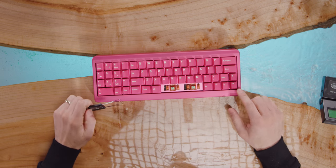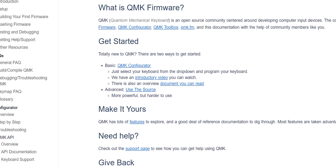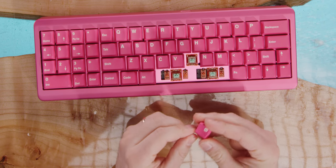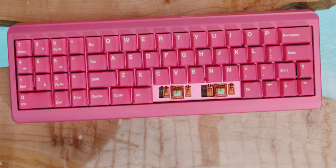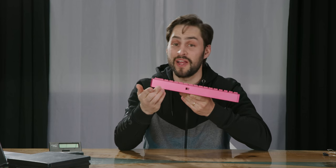After you're done assembling it, you're not quite done, because you actually need to program the layout you've chosen. On this one the arrow keys are all broken up and weird, but it doesn't have to be like that — you can put the key caps wherever you want. Then you program the QMK firmware and flash it on the board to do whatever you want it to do. It might sound a little daunting, but it's not that hard — there are lots of tutorials and tools online. These keycaps are dye sublimated, so they won't fade or get shiny from the grease on your hands. Not included in the box are stabilizers — these are GMK screw-in stabilizers designed to the Cherry spec, sold separately. And there is a USB-C port for a cable, but a cable is not included in the box — kind of a drag, but another thing you can customize.